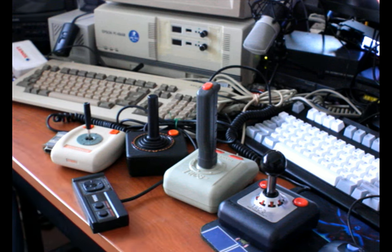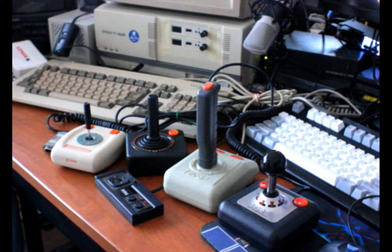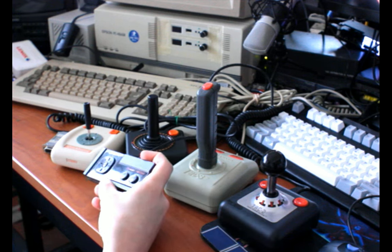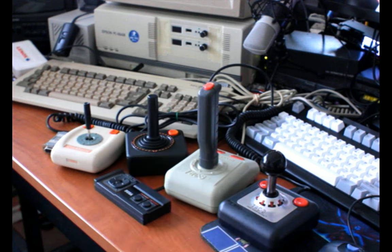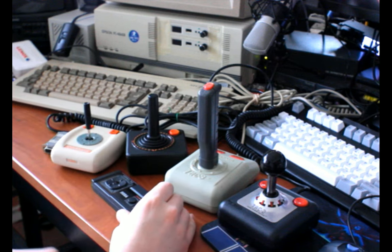Here's a small collection of input devices for Atari-style joysticks. I'm including a Sega Master System pad here. Mega Drive pads, Genesis pads, also will work, except, of course, you only get the one fire button, with an actual Atari 2600, that is. Some other systems that use a D-sub input might support both buttons. But there's a certain amount that's standardized between these and a lot that isn't.